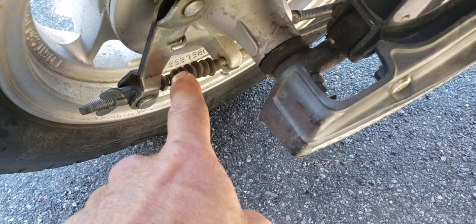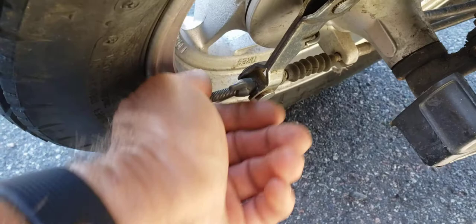You've got this wing nut right here and there's a backing nut. If it's dirty or not well oiled you've got to hold a wrench back here, but they're usually pretty free, at least in the front. You just back off and twist — I do one or two twists at a time — then get back up here and check it. You want about that much free play.